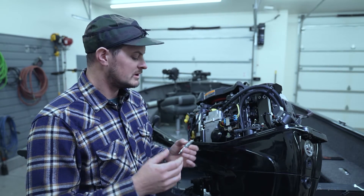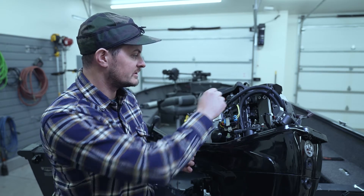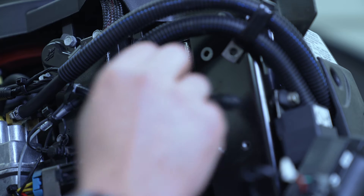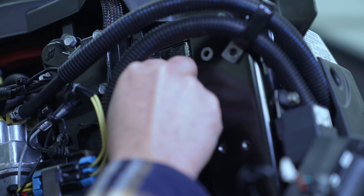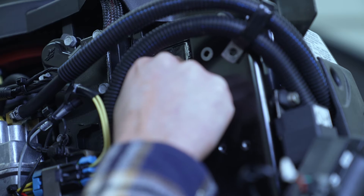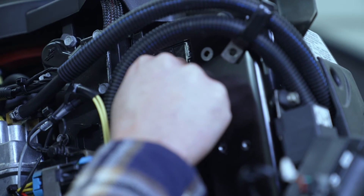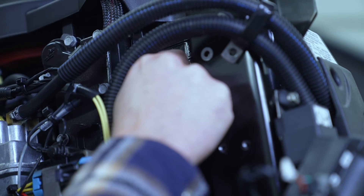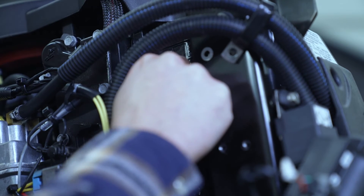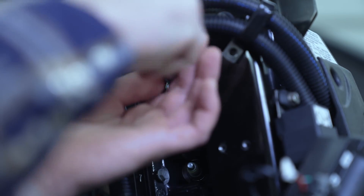Whether you're putting an old spark plug in or replacing a new one, you want to make sure that there's no debris, dirt, or dust on the spark plug or the spark plug seat itself. When installing spark plugs, you want to start them finger tight and get them down snug finger tight. You don't want to put it on a socket and start wrenching on it in case you're cross-threading the threads on the spark plug. So we're just going to go ahead and put this down finger tight, maybe using an extension without the wrench.